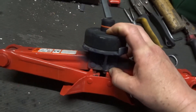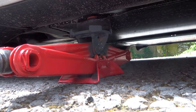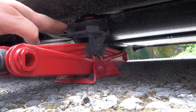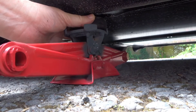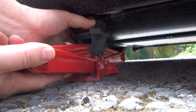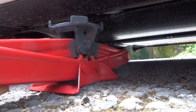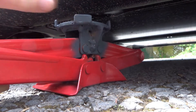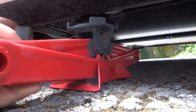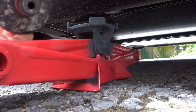So I need to test this and see if it actually works on the Tesla. The first thing to think about is that if there's a puncture the car will actually be maybe a centimeter or two lower than this - so can you even get the jack in? You can, if you put the puck in then slide the jack in. In fact I'm going to remove one of these tangs because I might need the extra few millimeters of space to get it in. I could even cut down the rubber puck so it's about half the thickness, which will gain me another centimeter.